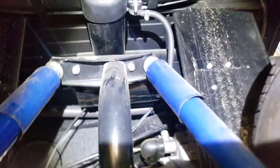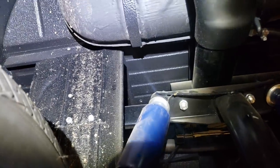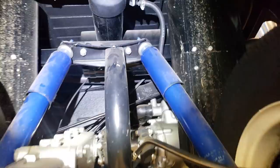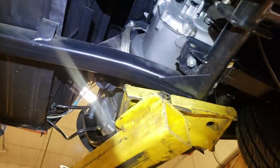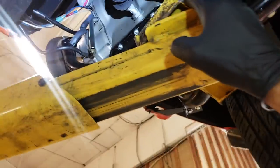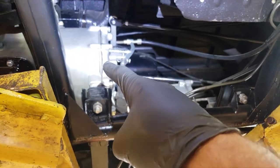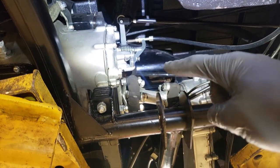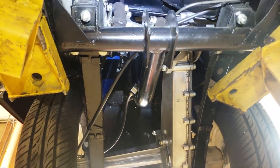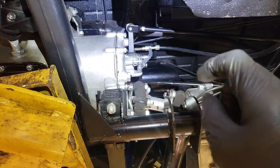The air filter canister then goes to the carburetor — it's filtered air. We have our metal mud flaps; you can see the tires have spit a little mud on there. The whole underside of this car has been Rhino-lined — beautiful up in there. So we've got our transmission, which is grounded with a ground strap. The transmission and engine are separated right here. This is your engine oil sump — it's a one-cylinder 300cc overhead cam air-cooled engine producing about 13 horsepower. All that power goes through a four-speed H-pattern transmission; that's your clutch lever on the very end, goes through the shaft, through the chain case, and out to the rear wheels. Pretty simple.